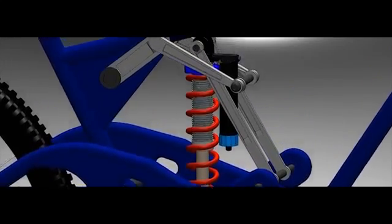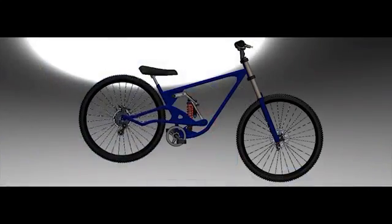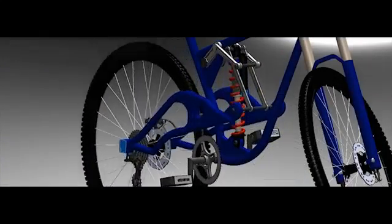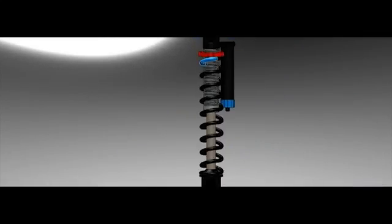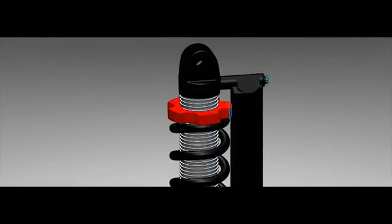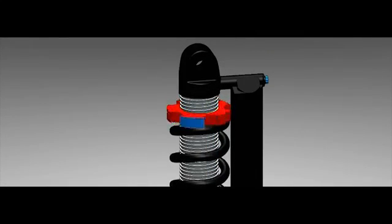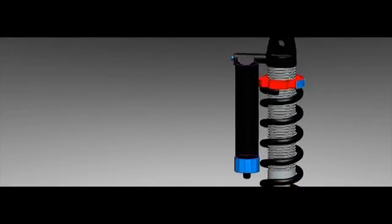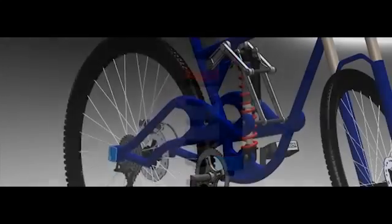The shock connects through a complex linkage system. The spring itself is a sub-assembly including intensive mating to allow realistic spring movement. The damper includes a threaded shock body and a piston system with spring perches on both ends. The blue spring perch nut allows for adjustable preload in the spring, and on the side of the damper is a piggyback air booster which allows further stiffening of the suspension.